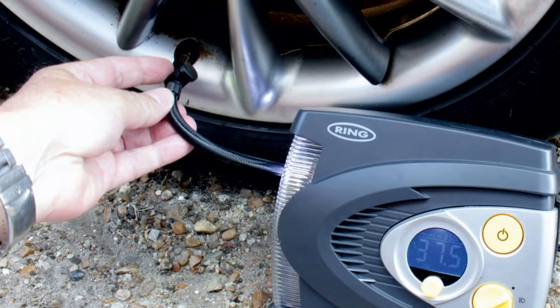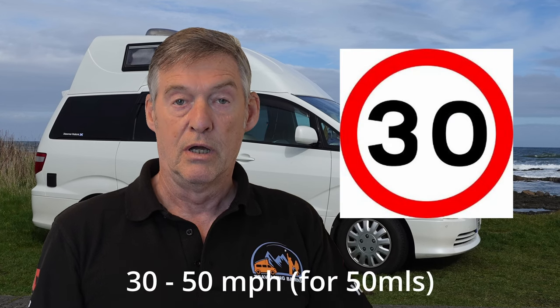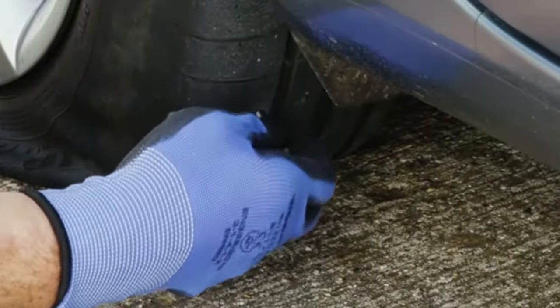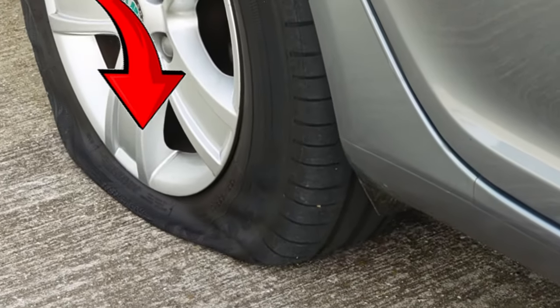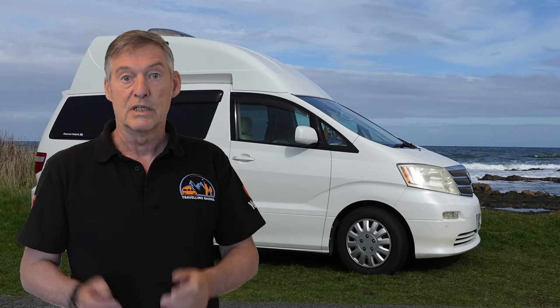Rather than changing your spare wheel, you can use a tyre foam inflator. It's really quite quick and you can still travel up to 30 miles an hour. Once you relocate your puncture and remove the nail or the screw, drive slowly forward and put the puncture on the roadside facing down. Put your foam inflator into your adapter and blow the tyre up. The foam won't disperse out the puncture and it remains in the tyre, and that should do you good until you get the tyre changed in a safer location or get to a garage.